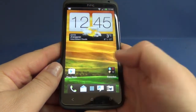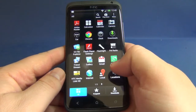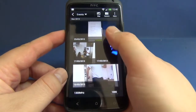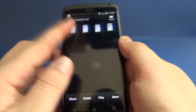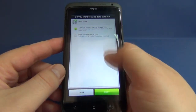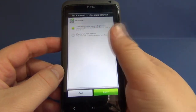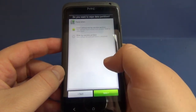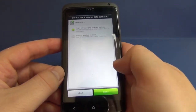This custom ROM comes with a ROM installer. I'll now show you the options you get when installing Android Revolution 19.2. The first option is whether you want to wipe the data partition — you can choose between install without wiping, or wipe my user data partition. I always choose to wipe my user data partition; I don't want to risk any issues.